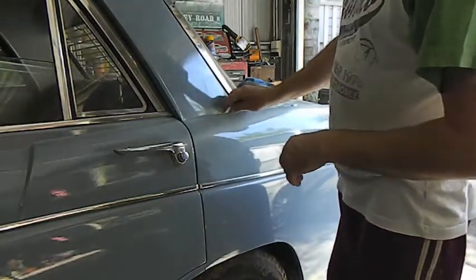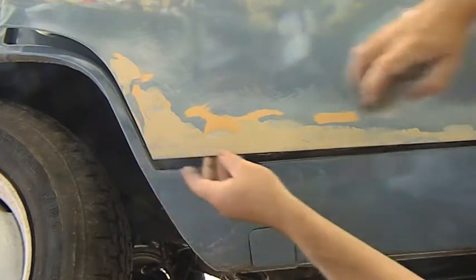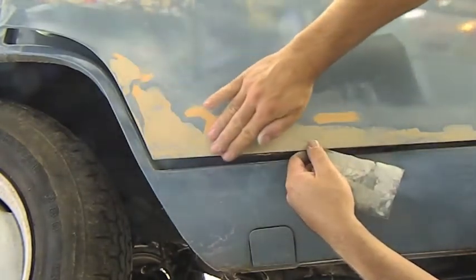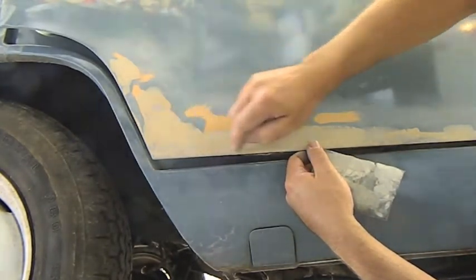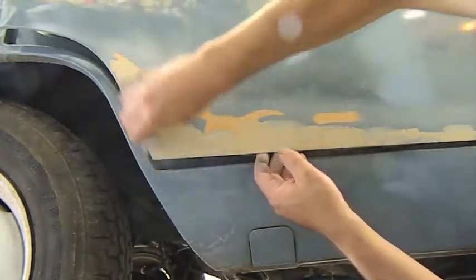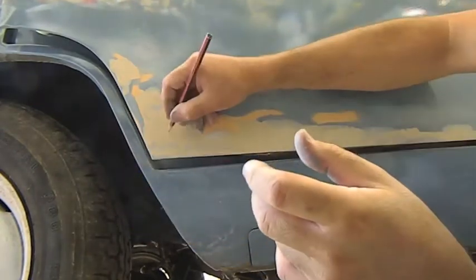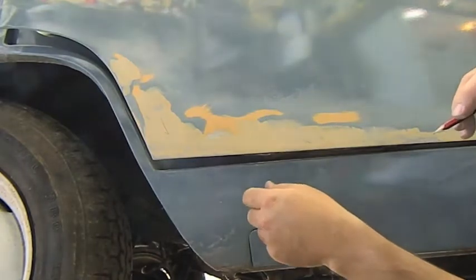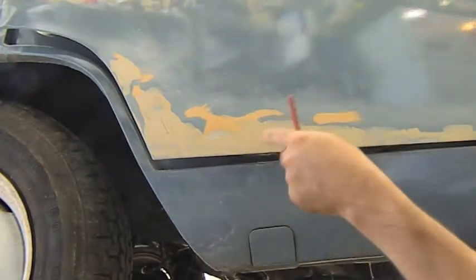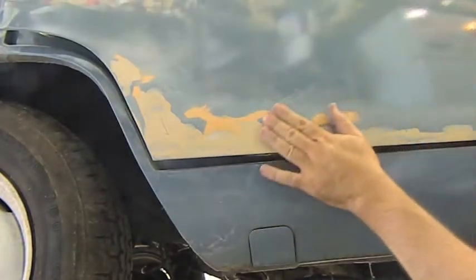This is where spending a lot of time will really yield a great result at the end. It's easy to pop the door open so you can get to the edges. You can see here where I've been circling with a pencil. Sometimes it takes a few applications to get it exactly the way you want. So you circle them and use a quick stop putty — a single pack putty in a tube. Once it feels all good, I always just tick them off. That way, if you've got about 20 repairs in the car like this one, you can see exactly where you've been. I don't think the graphite affects the primer, but I always rub it out before I start.